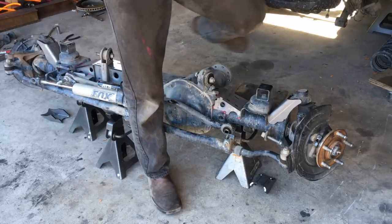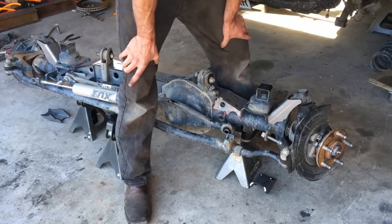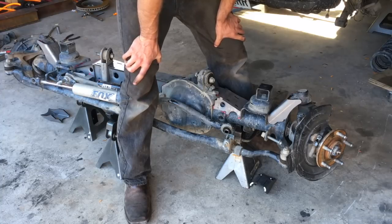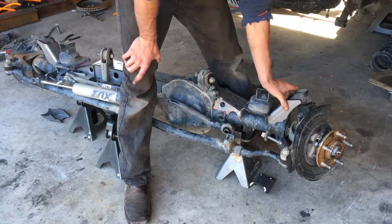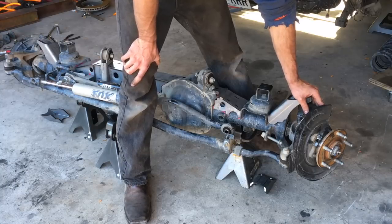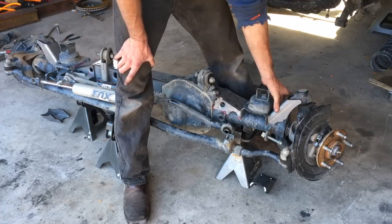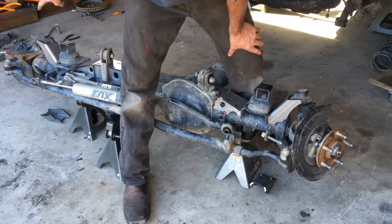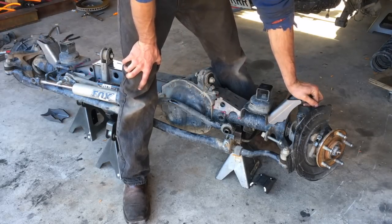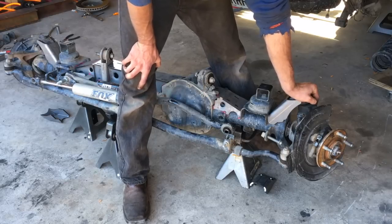If you're doing gussets, one smart thing: factory ball joints are going to go bad, no way around it. So either replace them at the same time since everything is already off, or end up with broken gussets later. If you're keeping your existing ball joints — or have nice aftermarket ones like Synergy or Dynatrac — weld slowly because too much heat will ruin them. Do half an inch, put a wet rag over it, do a couple tacks, then go to the other side. After each weld, put a wet rag on it and let it sit. This keeps it from getting red hot. Work your way around until everything is done and keep a rag on your ball joints.